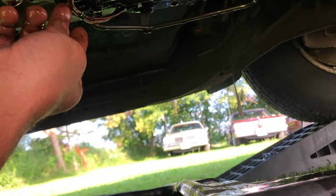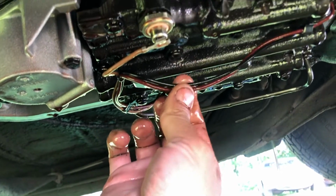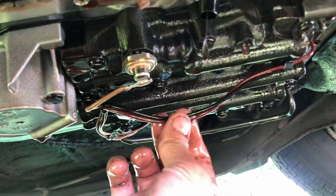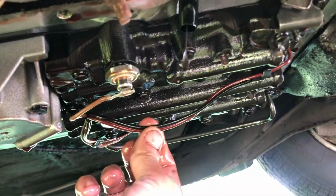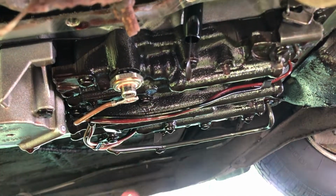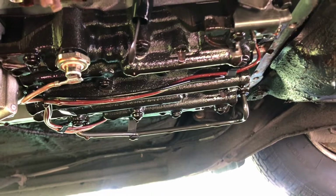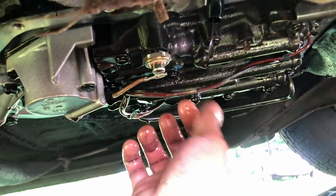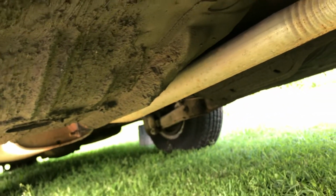After inspecting the wires, there's really nothing wrong over here that I can see with the wiring. I applied current to it. Sometimes you can hear a click, but I couldn't hear a click. So I tried to apply power with a switch and get it up to highway speeds, and the transmission did nothing. If it was engaged at low speeds, it would lug the engine and possibly even stall it out. But that's not good either. So I'm gonna try and see if I can change this and hope for the best here. I really want this lockup to work, and if I don't get it working, at least there's fresh fluid and filter in it. Everything else looks good. There is an exhaust leak with the old girl too, so that'll have to be addressed at some point.